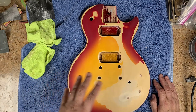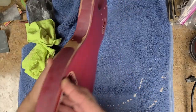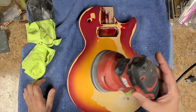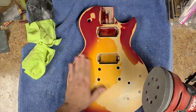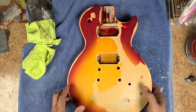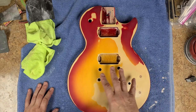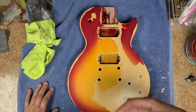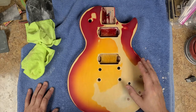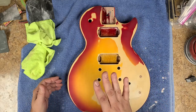This is going to get sprayed black silver and candy green. So I got it all sanded down really nice and flat — no waviness, no nothing. That's what I kind of like about using my rotary sander. I got a pad on here for doing tops like this, which works out really good for flat surfaces. I remove the pad and then go with the sandpaper on the flat surface, sanded it down with 320 — closest thing I have to 400. Being a rotary sander you don't get the scratches that you would from 400 grit or 320 grit sandpaper when sanding by hand, leaving scratch marks going in the direction you are sanding. So this is nice and smooth and it's ready to be painted.